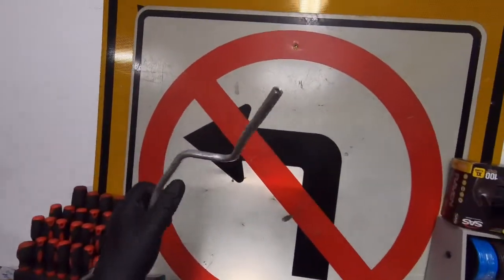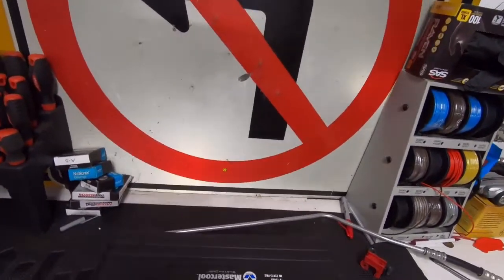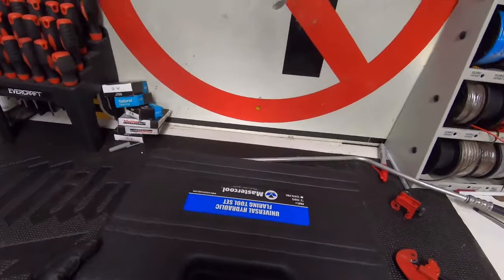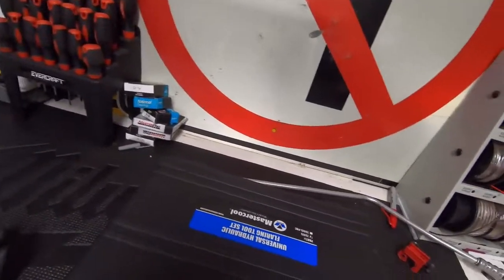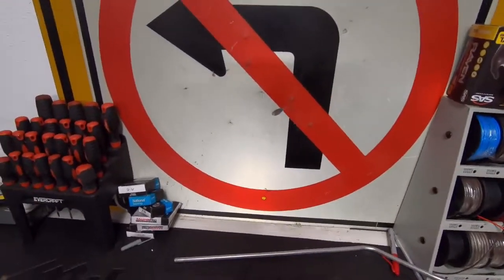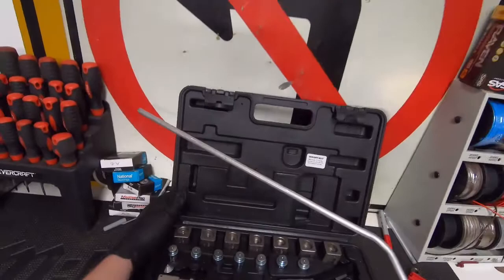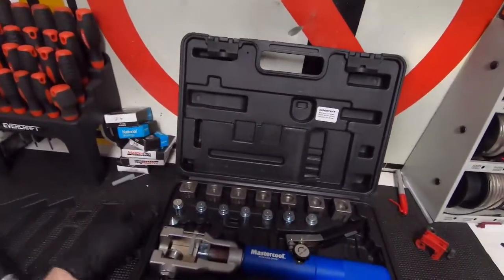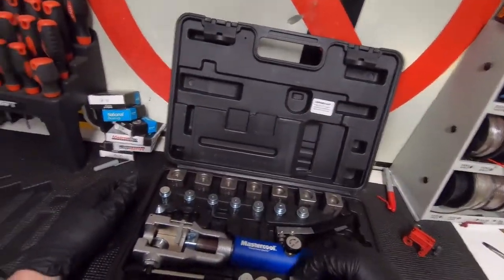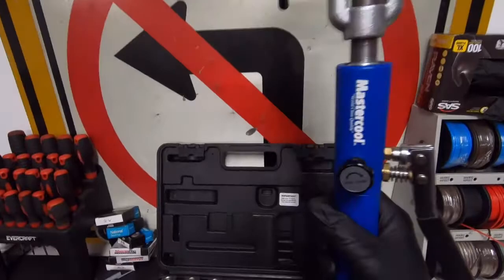Now that we've got that all nice and smooth, I'm going to show you another tool. It's a bit spendy, but if you're going to build a car and modify the fuel lines or the brake lines, I suggest you get it. It's going to save you a lot of time running around looking for fittings that may not exist, and the parts guys won't look at you like you're crazy when you ask for them. It's a Master Cool universal flaring tool — I'll put a link in the description. It'll do inverted flares, regular flares, and it'll make quick connect fittings. You can even buy other dies and do other things. This is definitely a tool I wish I had known about sooner — I do not regret buying it at all.